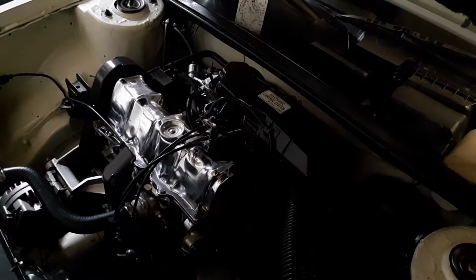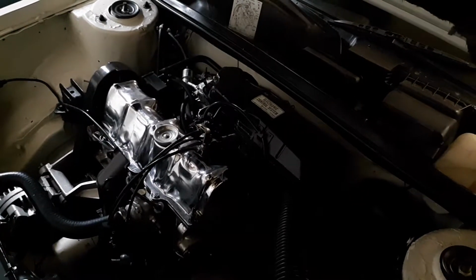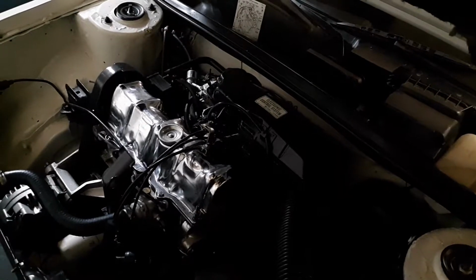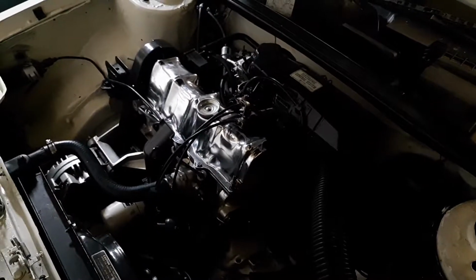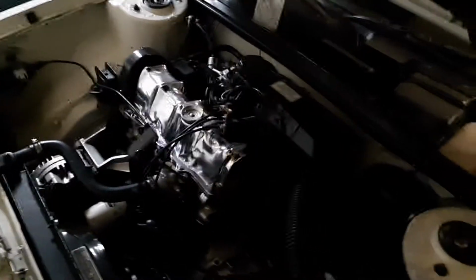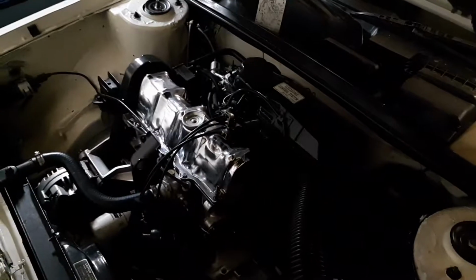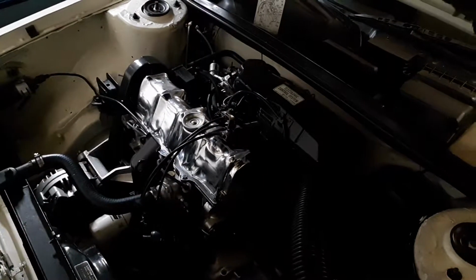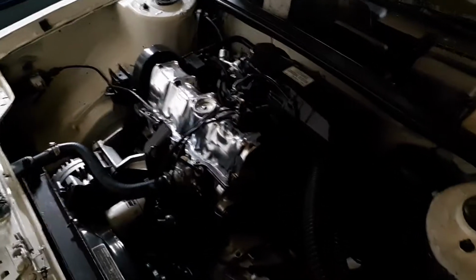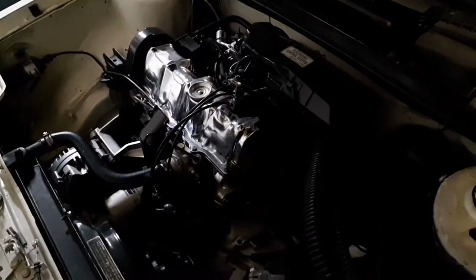And third thing, the carburetor is a non-feedback 5220 from a Rampage that I got in the junkyard for 25 bucks. In a package deal, I also got the jetting kit. On top of that, I had another carburetor from a Volkswagen 1.7 liter Omni, and the secondary jets are huge on those, bigger than what's in my Mopar kit. In fact, the secondary on this is a 535, and my primary is a 235.